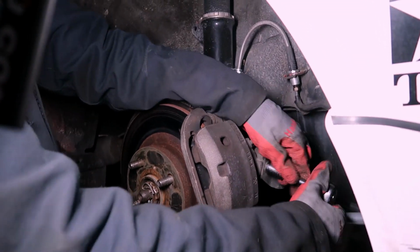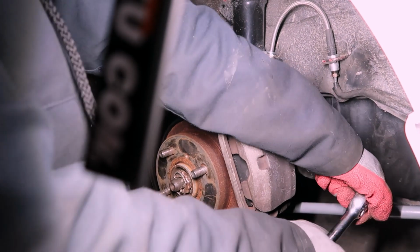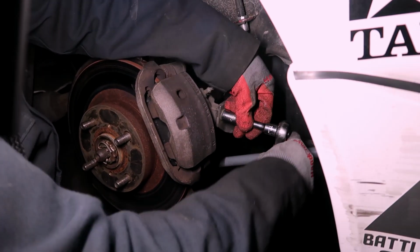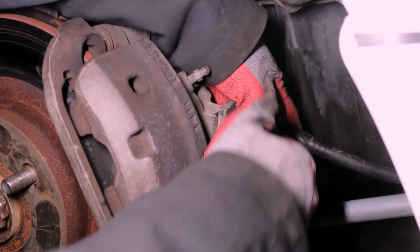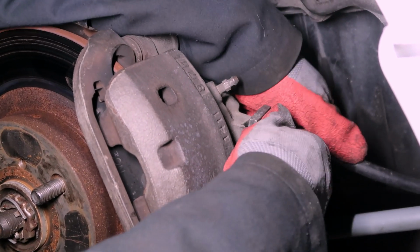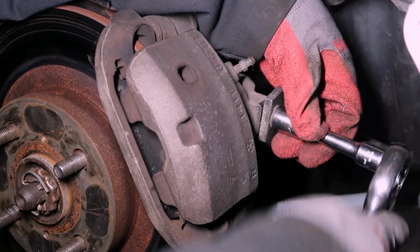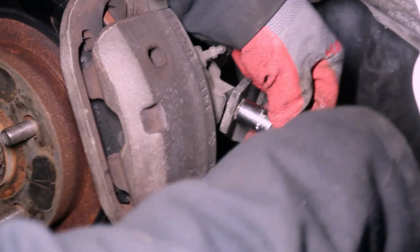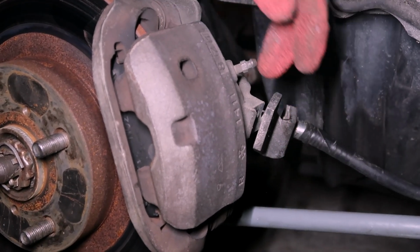Follow me for more tips and tricks. Oh, that. This dude really turning it the wrong way. This dude really just cross-threading everything, huh? This is the right way, and we didn't do this. But yeah, see how much it's pulling out? That means there's a lot of tension on the handbrake. So I feel like the handbrake's just, since the pads are thicker than stock, or at least felt like it, seized on there. But I think also the slider pins are a little seized, so we're just gonna clean it.